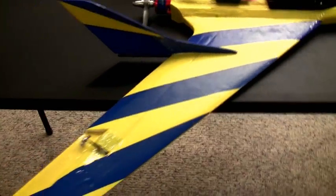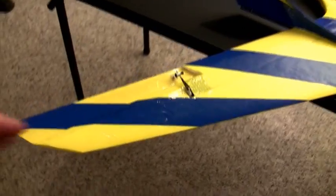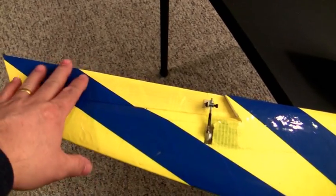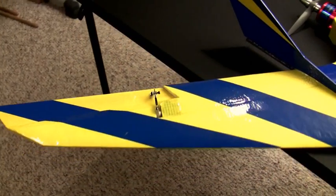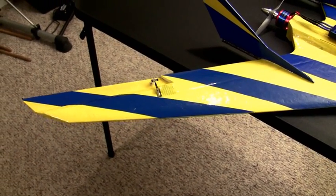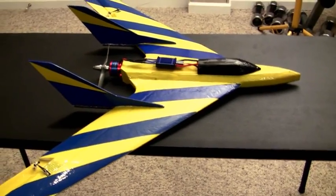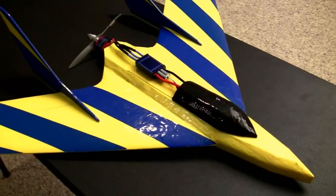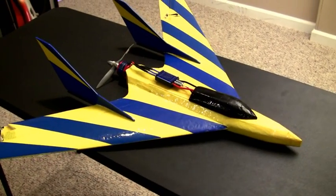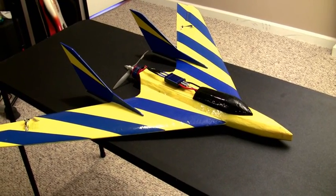The other thing I'm a little concerned with is some of you were mentioning the control surfaces being all the way out at the wing tips. I may, before I take it out to fly, try to rebuild that portion of the wing and move them more towards the center of the wing — that would probably help get rid of the touchiness. I haven't decided 100% on whether I'm going to do that or not yet; I may try to fly it first the way it is. That pretty much covers all the mods I did to the plane, and we're going to take a look at some of the other projects I've got going on now.